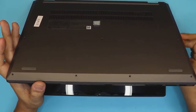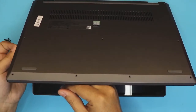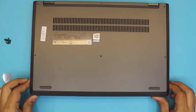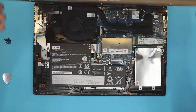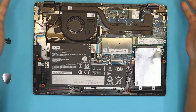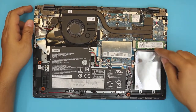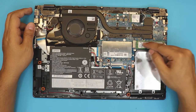Do the sides and do the other side. I usually do halfway through — you don't need to do the whole thing — and then close the laptop, lift up the bottom cover, wiggle it around, and it should just come out easy.